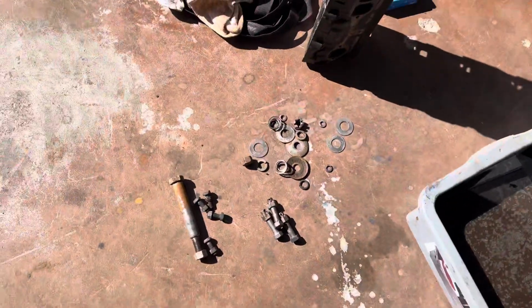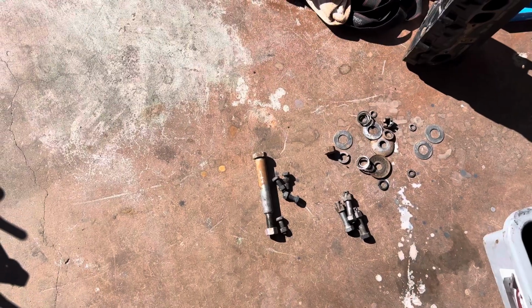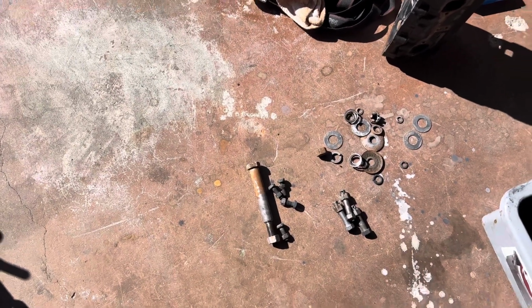Scrapey, scrapey, scrapey. Yep, this is just for the 2 ball joints to finish getting the rest of it out, as it was that bad. So now I got to get this mess cleaned up before Bobby gets here and kicks my ass. So, yep, and there's those. They'll go in next for the control arm. I'll do a light sanding on the big bolt and just kind of put a little bit of oil on it so that it doesn't get any more flash rust.